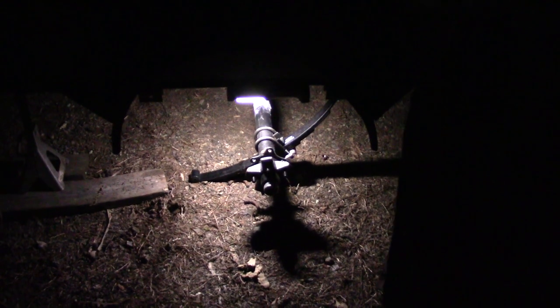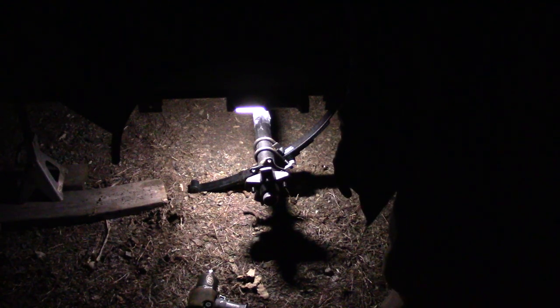I've got the axle set. This is an over-slung axle, which means it goes on top of the leaf springs. You always want to look for that arch - it should be arched upwards - and then the plate goes on the bottom. I'm going to pull apart the u-bolt kit and get that on. The easiest way is to attach the spring at the front, get everything attached loosely, then cantilever that up onto the trailer. There are actually four bolts, two on each side, because you have a small shackle piece that goes on the rear.